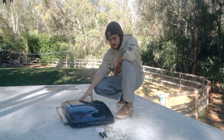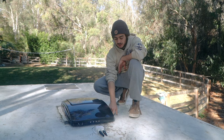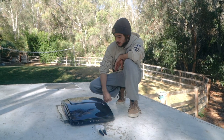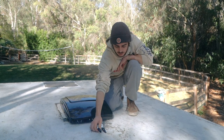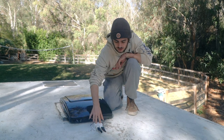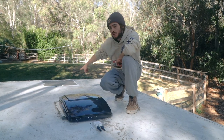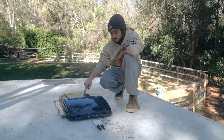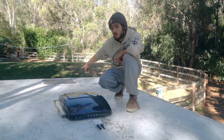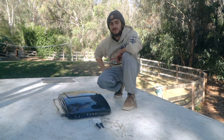We're back up here on the roof and we installed our vent fan. It's been a couple of weeks because we just forgot to film this last clip, but the lap sealant has dried and we have a nice seal now. We also installed a solar panel entry gland right here — these are our solar panel cables and we just drilled a hole and glued this down with some urethane adhesive. Up here where the old vent fan was, we used the sheet metal that was in this part of the roof, drilled it in over the old hole, and lap sealanted around that. That's pretty much the update — we'll see you next time.